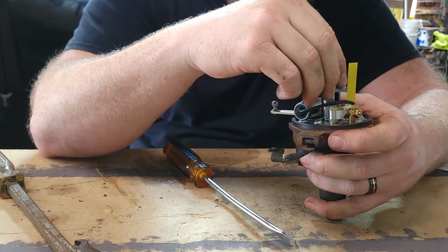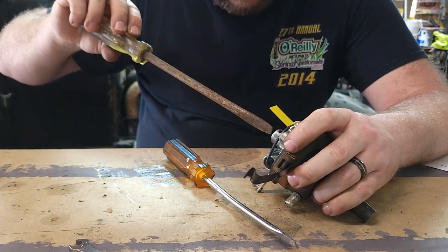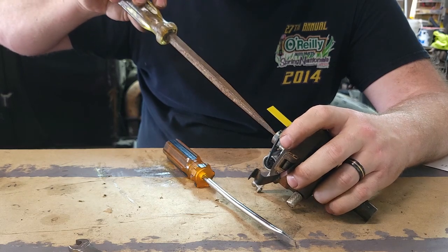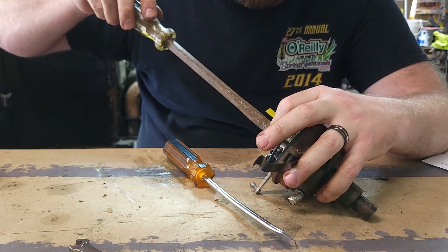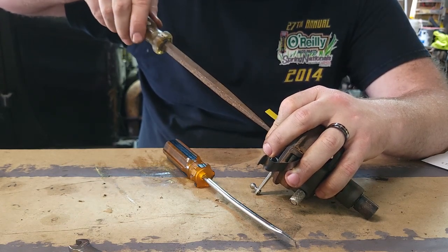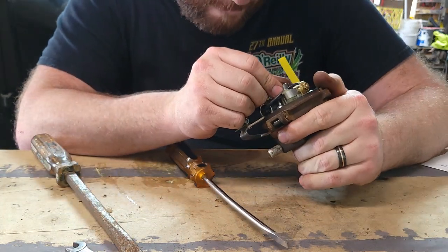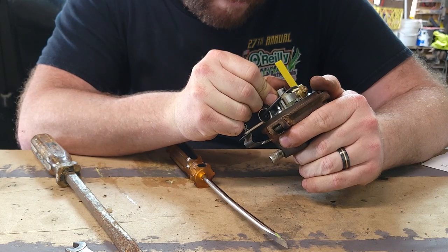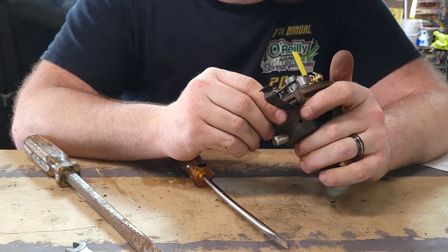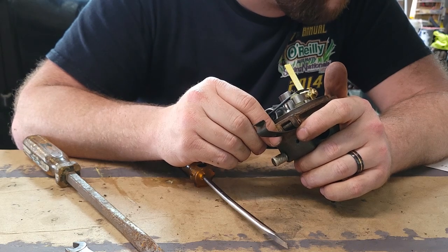I'd probably say that if you're going to put this on, you should adjust the points and the bracket while it's on the motor. I already put the screw in for the cam — don't tighten down that screw that holds the cam to the distributor shaft until the distributor is on the vehicle and you're timing it for top dead center. I show you how to do that in the video linked in the description. I appreciate you guys watching — please consider subscribing, liking, and commenting. Hopefully this was good information on how to replace the upper plate with a modern upper plate and a wireless lower plate.